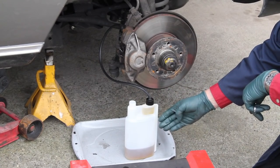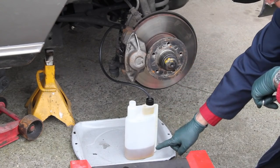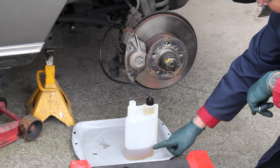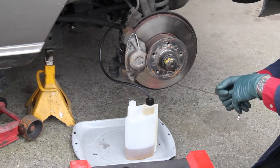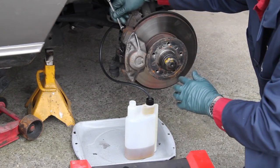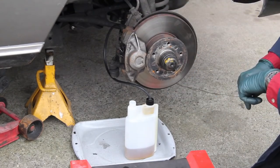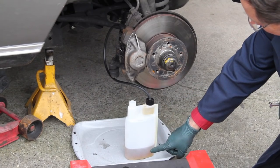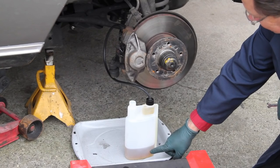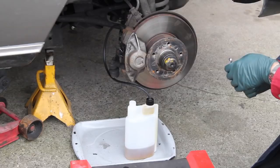This accomplishes that objective of being able to see when I've got clean fluid coming out of the brake caliper. And being one liter in size, it's big enough to do all four wheels. I always do a little bit more flush on the first wheel because you're going to be getting a lot of that crud out of the brake master cylinder reservoir. So I'll go ahead and close this one off — this one's done. You can see the difference here between this clean brake fluid and the old dirty fluid down here. Isn't that amazing? I'll move on to the next wheels and complete the brake fluid flush.